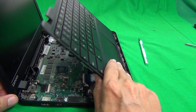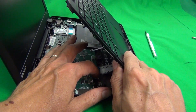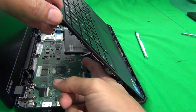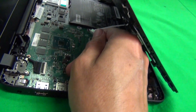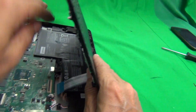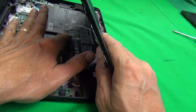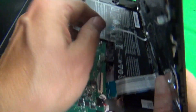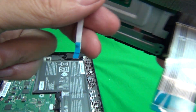On the bottom, once you've lifted up the keyboard assembly, you lift it up from the screen side. On the bottom there are two connector cables — you've got to lift the plastic bars on the bigger keyboard cable and the smaller trackpad cable. You can use your fingernail to lift it up, or reach in with a hobby knife and lift it up, and do the same on the other one. The cables then come out. When putting the Chromebook back together, put this cable in first and put the bar down first, because this one's a little bit tricky — you have to push it into the opening. When you put the bar down, make sure the end of the plastic bar — the white bar — lines up with this black line on the connector. That's how you know it's properly connected and the touchpad will work properly.